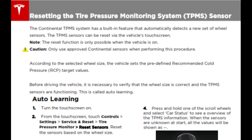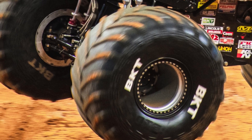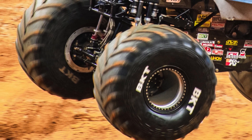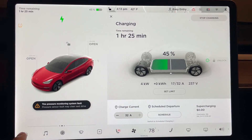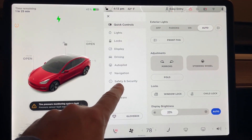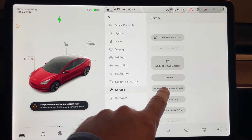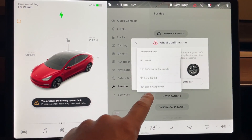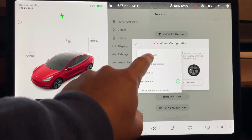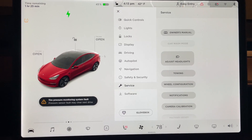If this doesn't work, consult the manual or Google to find some troubleshooting. If you put on a different style wheel than the wheels you took off — for example swapping 18-inch wheels out for 19-inch — then you'll have to make that change in your Tesla's wheel configuration option within the service menu. You can do that by touching the controls icon, the little car icon on the bottom left of the screen. From there, choose the service menu and then find the wheel configuration button. Then scroll to find your wheel and confirm. Now your Tesla knows what wheels it has. Updating your wheel configuration can impact range estimates, tire pressure warning levels, and vehicle visualization.